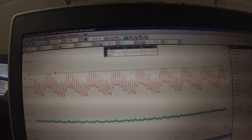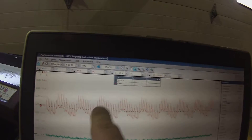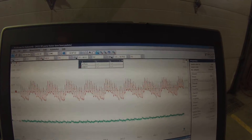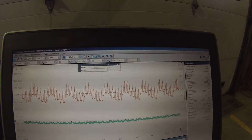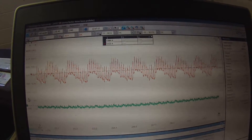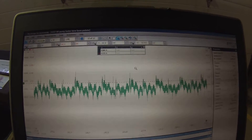There is a night-and-day difference here. You've got all these current humps from the motor, and the humps are more defined on the good pump. At peak you have about 5 amps; then down at about four and a half amps. You go here on Channel C to the very top — it's at four. But I'm looking at the definition: see how you've got nice clean humps on the good one? Now if you look at the one on the bottom on Channel C, it is not even close. It is all botchy — it's missing beats. The pump is junk; it's going bad.